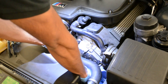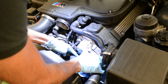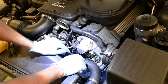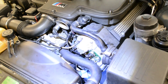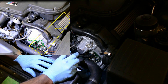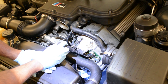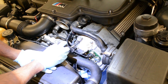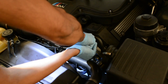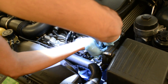There's a towel underneath so that the solenoid oil doesn't splash all over the place. There's a small cover gasket and this is going to be tricky — you have to pry it off using a flat-head screwdriver. These two solenoids belong to the intake and these two belong to the exhaust. To remove them, use a flat screwdriver starting from the bottom one. Never pull it from above — that will damage the solenoid directly.